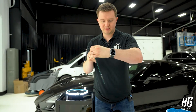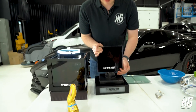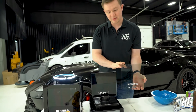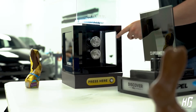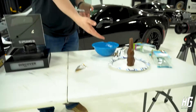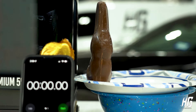We're going to go ahead and switch out the CS Black 5% for the XR Plus 70%. Clearly, as you can see, there's quite a bit of difference in terms of light. This is 70% — it's allowing 70% of light through. Let's see what these ceramic properties can do for our sad bunny over here. Testing glass number two with the XR Plus 70%.